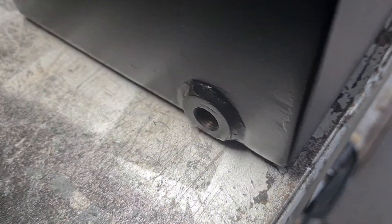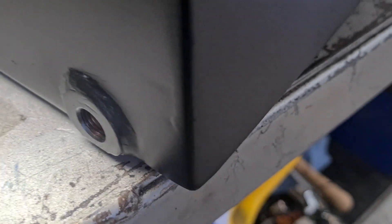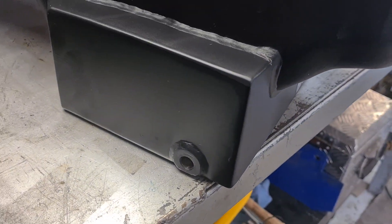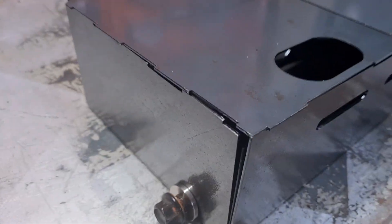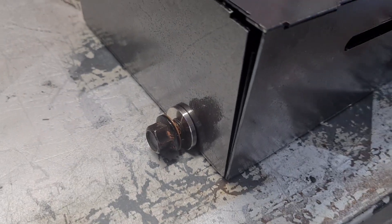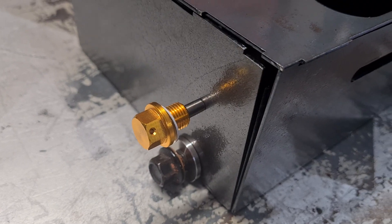You can also see the little magnet. The drain plug is right on the bottom, but I've put it on the side so it doesn't get damaged by speed bumps and those kind of things, and I've put it as low as I can so it'll get all the oil out without getting damaged. It takes a standard sump plug so it just screws straight in — you can run a really cool magnetic one if you want, or the standard one, doesn't matter.